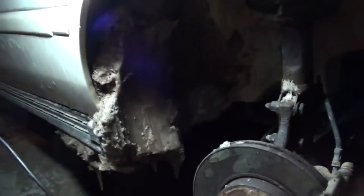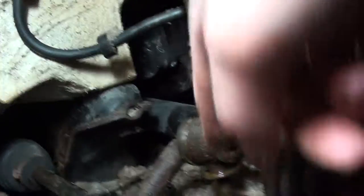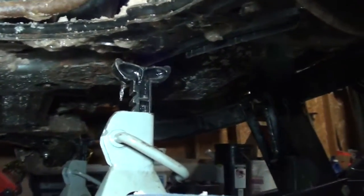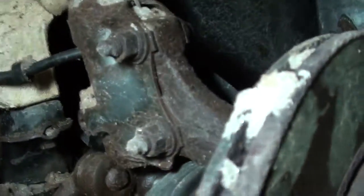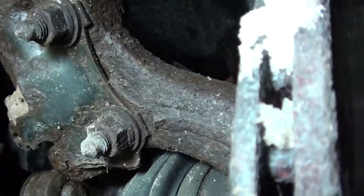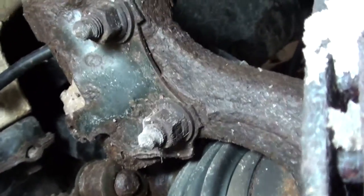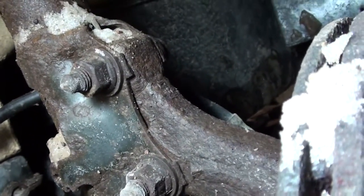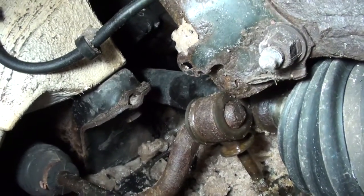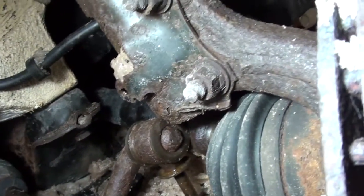You're gonna come down over here right next to the driveshaft boot — that's where the sway bar link is. Underneath there is a 13mm nut that you have to take off, and then I hit it upwards with a hammer to get it out of the hole and remove some of the bushings. This one's completely out now. Once you do that, take the bushings out. This one was really rusty so I sprayed it with PB Blaster and turned it left and right, clockwise and counterclockwise, to loosen it up, and then it pulled itself off.